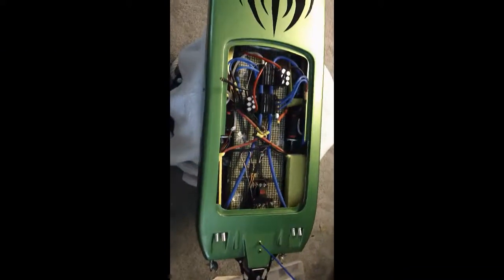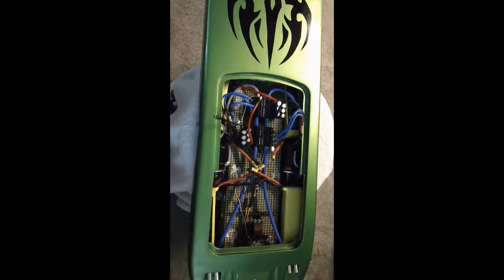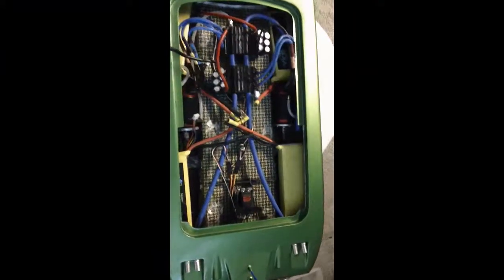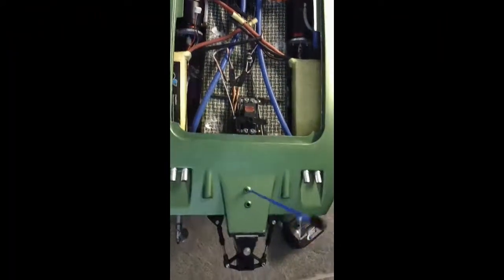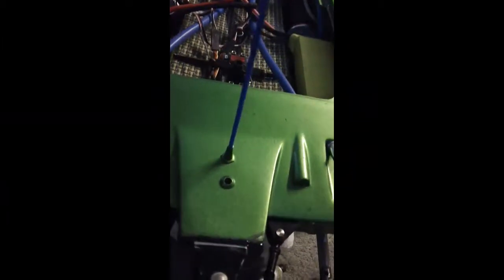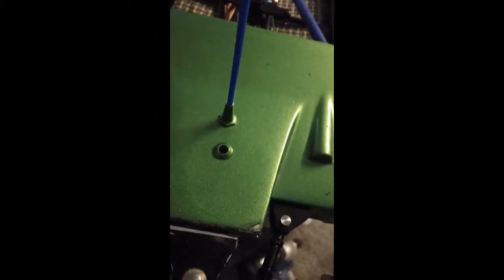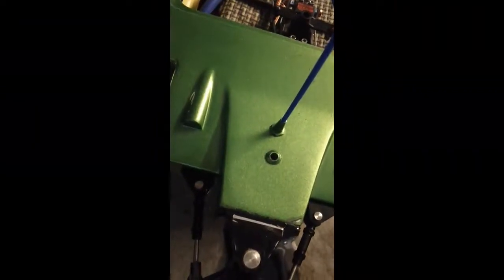This is the Zonda layout in 6S with four 3-cell LiPos in place. The servo is in place but the wires aren't hooked up yet. I need some bicycle cable guide — that flexible stuff — it mounts in the holes I've drilled in both sides, guides through, and then you put a rubber grommet that flexes on the ends to keep it watertight from the inside.